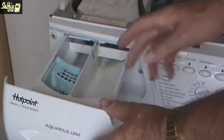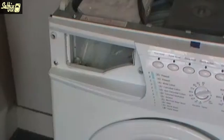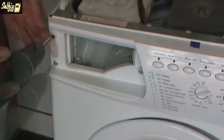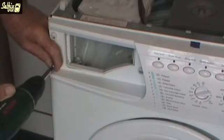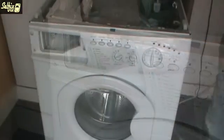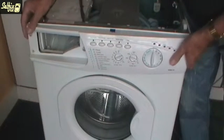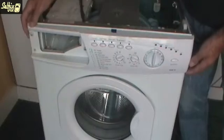Pull the soap drawer out as far as it will come, then press down on the blue centre tab and pull it all the way out. Remove the stainless steel screws from the drawer opening and you can slide the fascia panel to the right. This will unhook it from the bracket which is holding it to the cabinet. Be careful with it because of the wires that attach to the module. Ease it forward and fold it over so you can get access to the wiring harness.